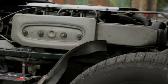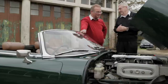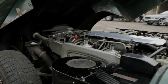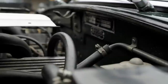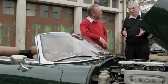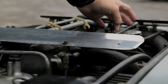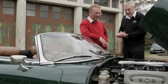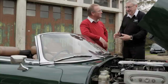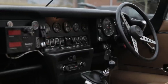The V12 engines are virtually unburstable, but they must be well-maintained. Head gaskets can be a problem — this is an all-aluminium engine, so you can have major problems if they're not filled with the right percentage of antifreeze, if the oil isn't changed regularly and all the rest of it. The simple thing that can go wrong is this beautifully engineered capstan that operates the throttle linkages for all the carburettors. If it's wrongly adjusted, you'll never get the performance out of the car — you'll never get the feeling of what the V12 is really like. It's getting the details right.